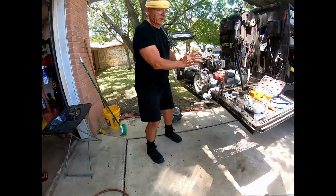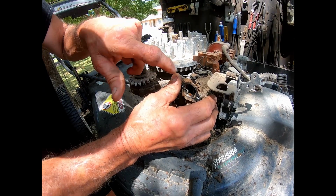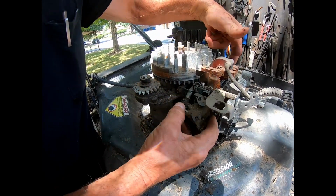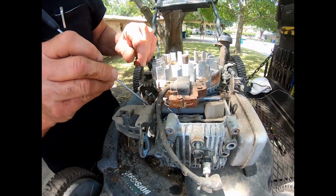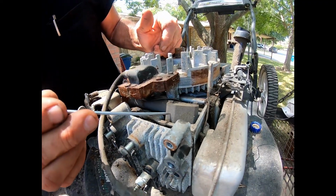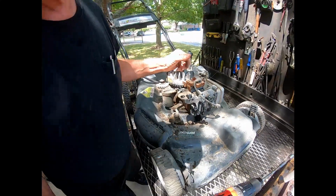When it initially chokes, there's not enough air mass flowing through the carburetor. Then when it's running, it's sucking a great amount of air in there. The airflow over that pickup tube sucks the fuel, just like you saw with the siphon hose, through this intake. This is, I guess, called the intake manifold. The carburetor's hooked here, and it runs the tube all the way across here to the intake valve. And then it sucks into the piston, fires it, and then blows it out the exhaust. And we'll get into that in a minute.